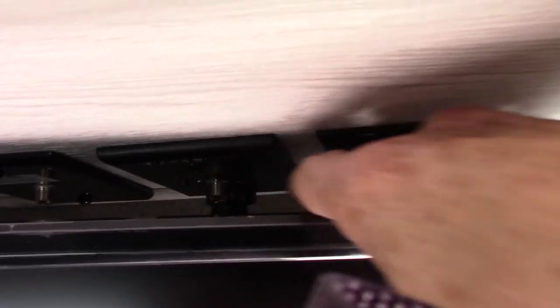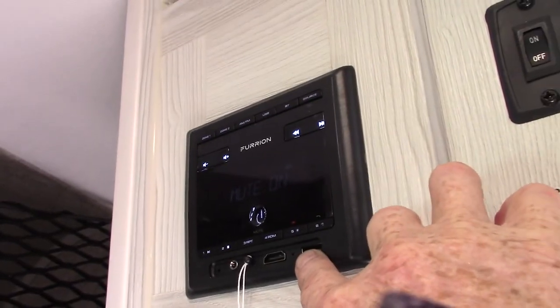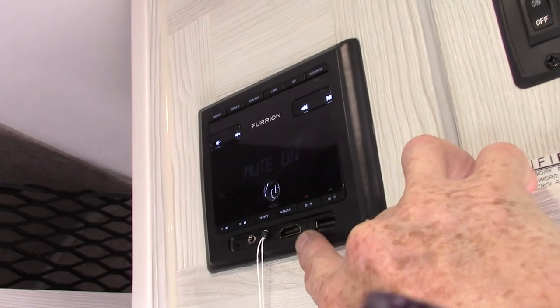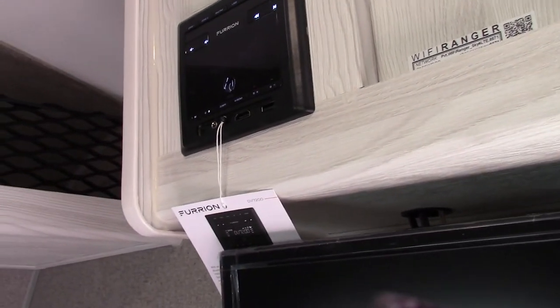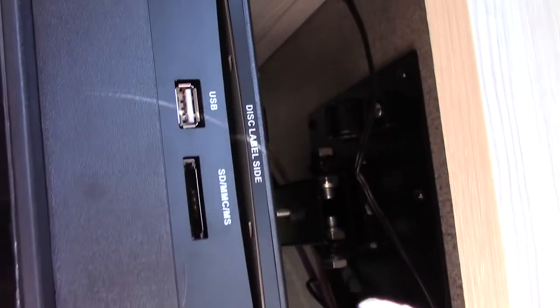Your TV is a 12 volt TV. This device here is the signal booster for the digital antenna — the pilot light should always be lit on it or you won't get a good picture. This is your antenna — it just rotates, it does not go up and down. For your sound, you can stream off a USB stick — put all your favorite albums on one stick and take it with you. Or hook up wirelessly with Bluetooth and stream from your phone or tablet. You can also connect with HDMI for a game machine. You have two speaker zones — one is inside, two is outside. The TV itself has a disc player plus SD card and USB inputs.